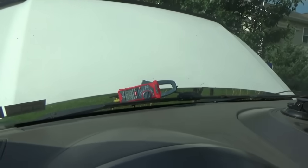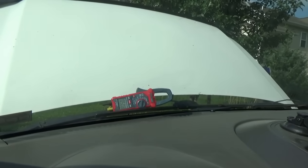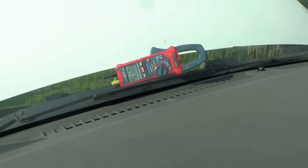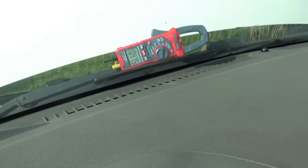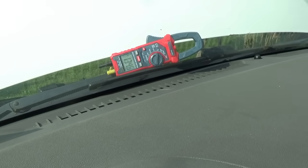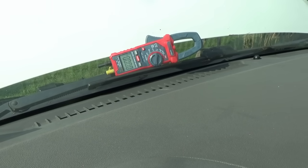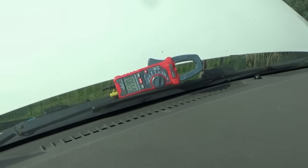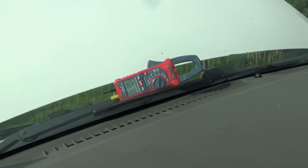So what do we have there — millivolts, about 50 millivolts, not too bad. On the ground side voltage drop, let's turn the key: 6.8 volts DC right there. I'm holding it in the crank position — that's our problem.